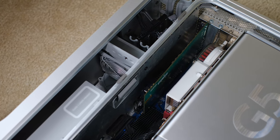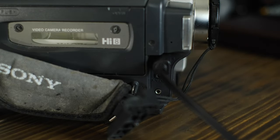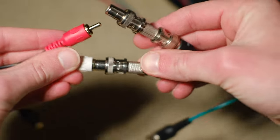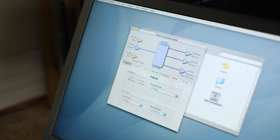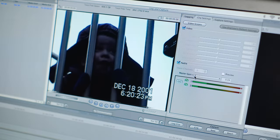The Kona LHE installs into the Power Mac like any other PCI card does, and once it's installed, we'll plug in its large breakout cable. This card can record pretty much any analog format — 480i to 1080p over composite, S-video, and component — and it'll accelerate video processing inside of Final Cut Pro 6. Since my camera outputs both composite and S-video at the same time, I'm going to connect the S-video output from the camera to a breakout cable that separates out the luma and chroma signals from the S-video connector, which I will then run into the luma and chroma inputs on the LHE's breakout cable. Then I'll run composite and sound from the camera through a JVC video monitor I happen to have lying around, and then run the audio from that into one of the inputs on the Power Mac.